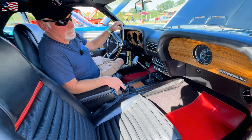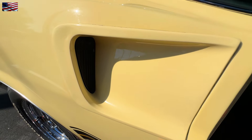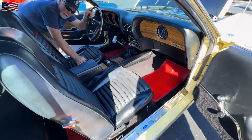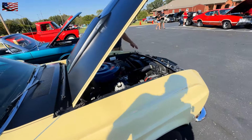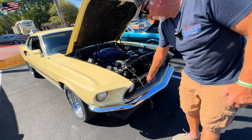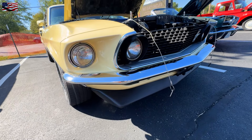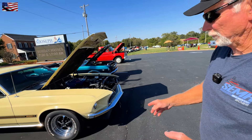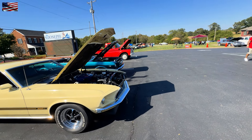Other differences between the 69 and 70 Mach 1: the 70 doesn't have that scoop on the quarter panel, and the back taillight stuff is different. The 69 was the only early-generation Mustang that had four headlights — the 70 went to two. On the 70 Mustang, there's a blacked-out panel up front, the headlights are in there, and they added a fog light in the grille. They also did away with the park light on the bottom. In 1970, they put a marker light in the rear quarter panel — that was a safety feature, it's a blinker. When they got out of the 60s, you had to add more safety.